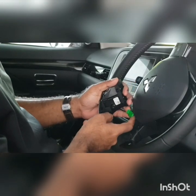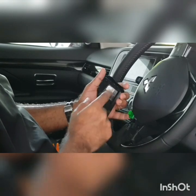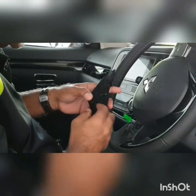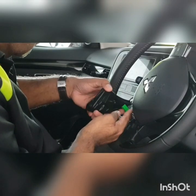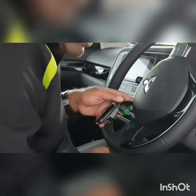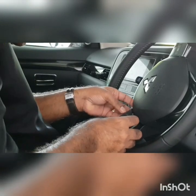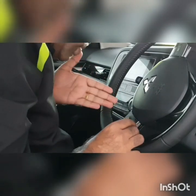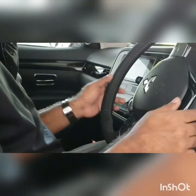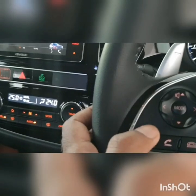There is a press clip — you need to press here to remove it. This is the adapter port I was talking about. This is the original one I'm replacing with the one I bought. It's just plug and play — I didn't do anything, just push it up. Put it back, slot it in, give a bit of push on this side to slot the wiring also inside, then press it back. That's it, you're done. Now fix back the screw.